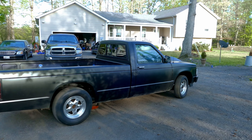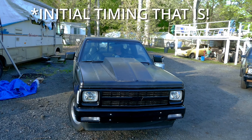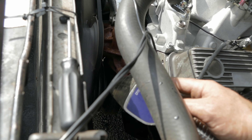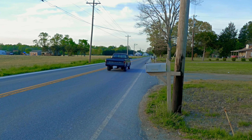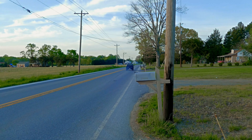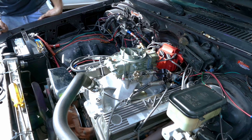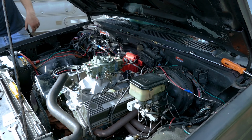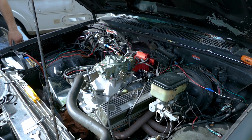We ended up getting it all sorted out and got it started. There's a couple of problems. Number one, I couldn't really put much timing in it because the initial timing was only around 10 degrees maybe, and then full advance was around 36 or over 36. So if you were to hit it real hard and the springs had opened up enough to give it advance, it would pop through the carburetor. The other issue — it had zero fuel pressure. It was only making like 2-3 psi and then sometimes it would shut off. There's a lot of things questionable on this vehicle, but I did the best I could with the time allowed to get it running. At least he can have this guy running and go down the street and have a little fun with it.